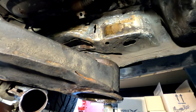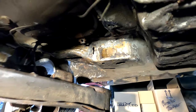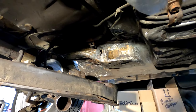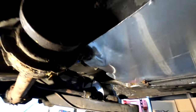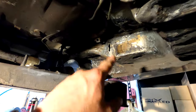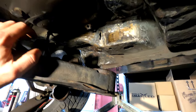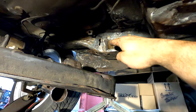All the angles are looking good, the alignment is looking fine. I've got a drive shaft stub in here just to verify the angles are okay when this is all jacked up — there's a sweet spot, obviously you can't go too low or too high because it affects the drive shaft angle.